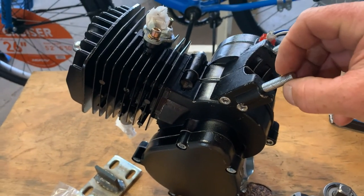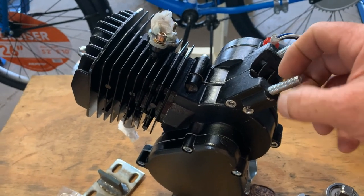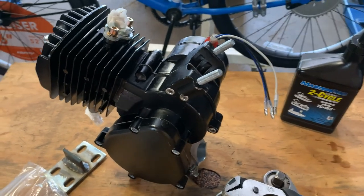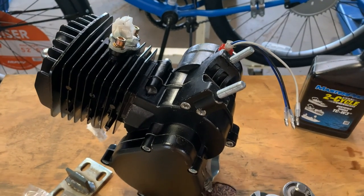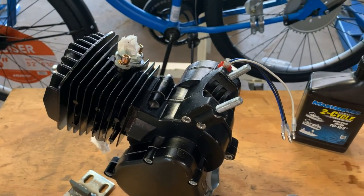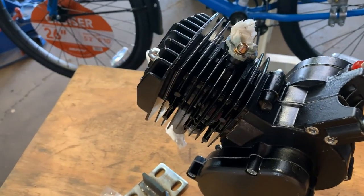You don't want to have a nut on there that is so mangled it crosses threads and completely strips it, ruining your chances of getting your bike going right then. That's a pain because then you've got to pull the stud out, go find some all-thread or a bolt or whatever to fix that situation. So that's just a friendly little tidbit there.